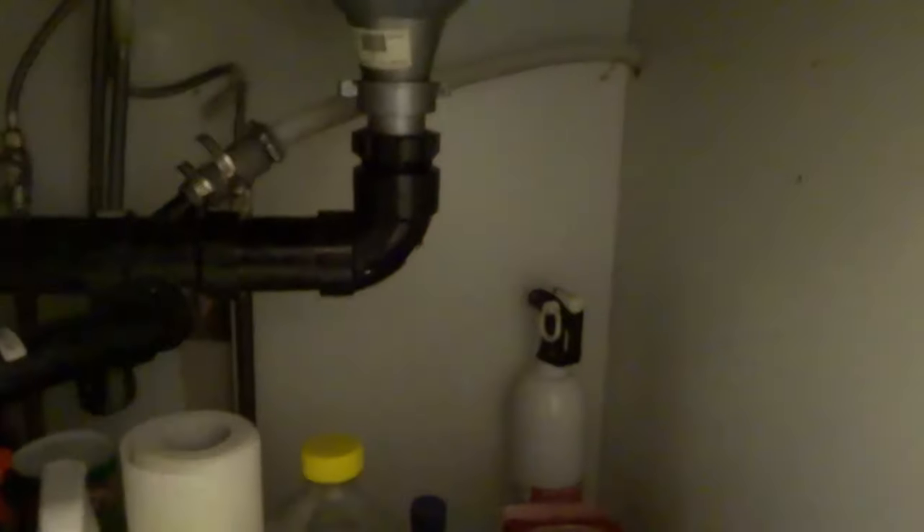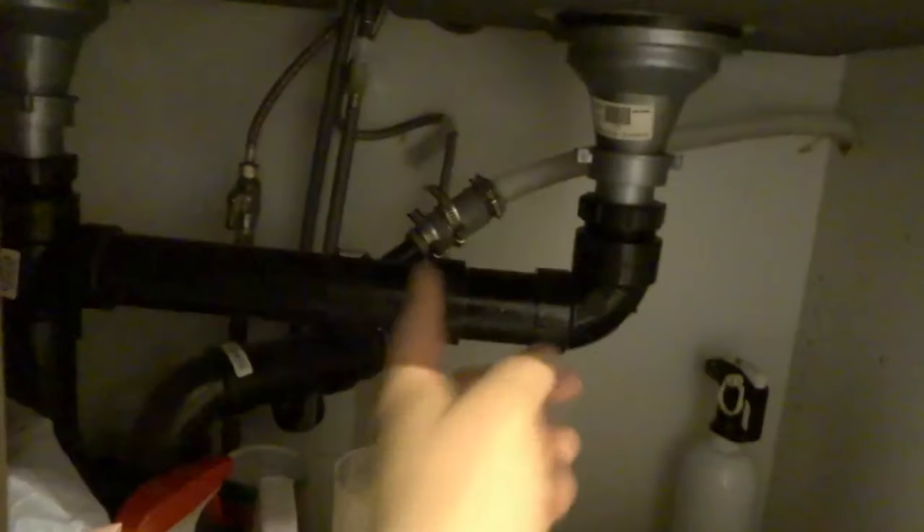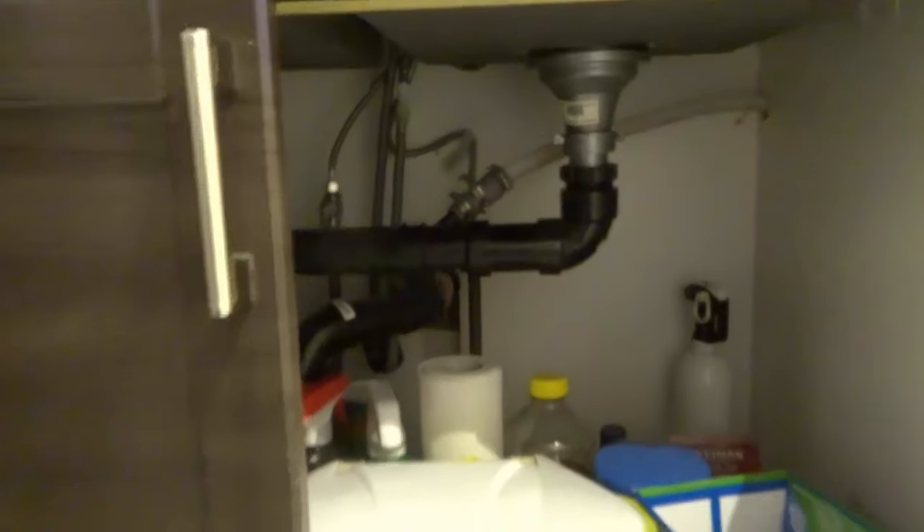You're looking for the one connected to the drain. You can hold a flashlight to it and see if you notice any shadows of anything caught in there — though there shouldn't be because you should have a drain filter. Look for any kinks or bends and try to clear that. If you're comfortable with it, you can also remove it from its connection, look inside, and then connect it back again. But only if you're comfortable, because if it's not connected properly the drain water is going to make a mess in your kitchen.